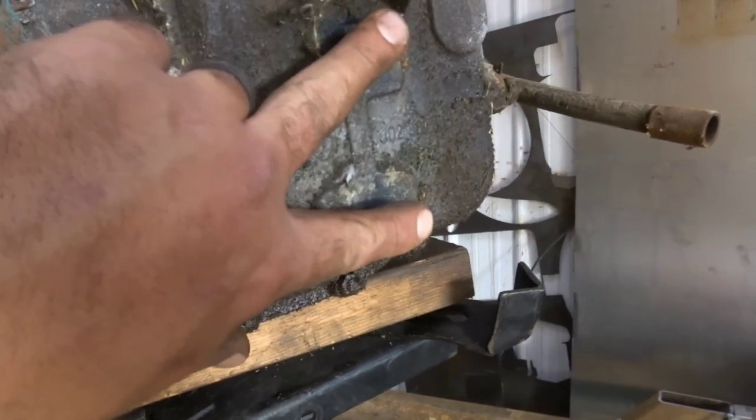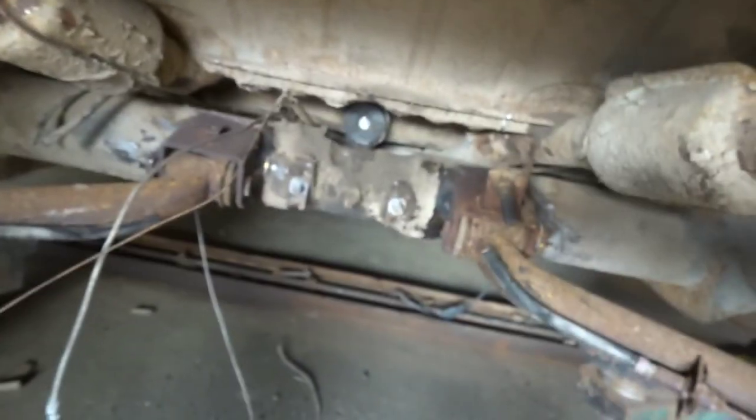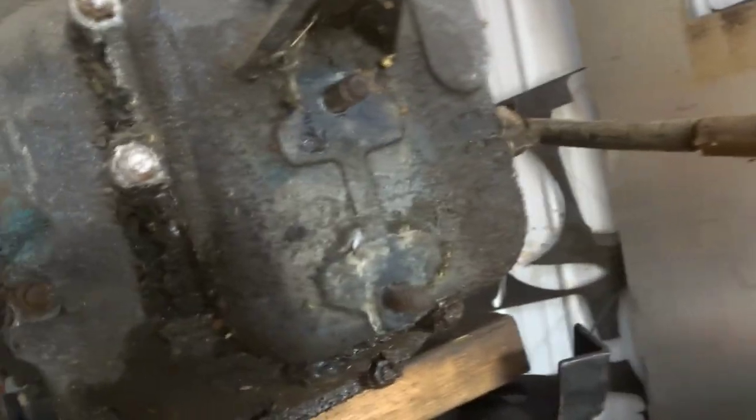Super excited to have the independent rear done. All that's left to do back here is weld everything up solid. Then build a mount that'll take these two bolts that are vertical and turn them into basically those two studs which are horizontal. Which seems super easy and shouldn't be an issue at all to come up with a mount that'll fit everything in there.